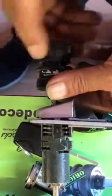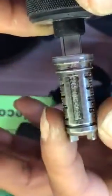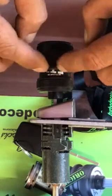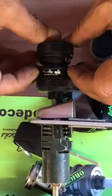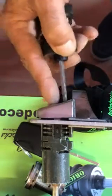As you see, we have opened now on the second stop sector, the lock turns. In fact, you can see that it's like a key here. All discs are in the diameter of the cylinder. To extract the tool from the lock, you must turn to the neutral lock position, turn the back wheel to the right, and now we have to close the pin access by pushing forward this ring. That can happen only in neutral lock position. We will hear a click and it will go in. Only in that way can you extract the tool from the lock.